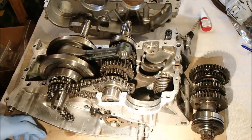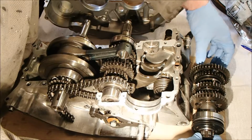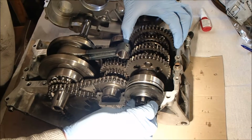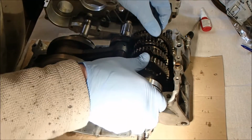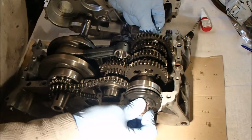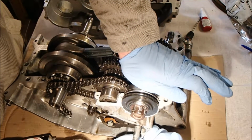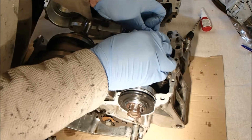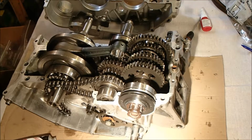Right, I'm going to drop this in now. I'm going to clear my hands and I'm going to come back to applying. Make sure that the selector forks line up. Check. Okay, drop that. Sometimes this takes a wiggle. Is that in? Nope. That's in. Right, hopefully when we torque that down everything will be pulled tight. Is that in? Is that locked? Feels locked. That's in the upright position. Right, to clean hand. In fact, change gloves. Keep any oil out of it.